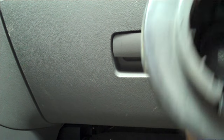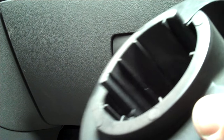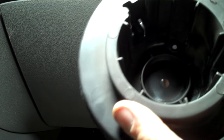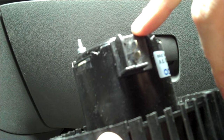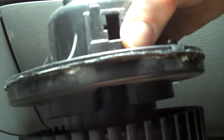Here's the old motor, which is not functional, and here's the housing. It's actually designed for this right from the factory — if you look, there are grooves for the prongs to slide right through. The whole thing is designed so it can be fixed this way. So you've got the cup here, here's your new motor, which spins a whole lot better than the other one did. You just line it all right back up again. Make sure that your connector will fit into the housing for it — right there where my thumb is — and the whole thing just slides right back down. Make sure you line it up, right over the top of the bolts.